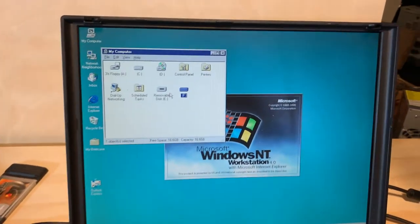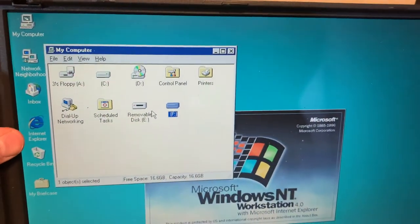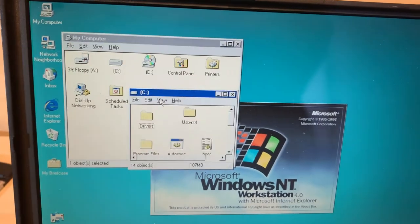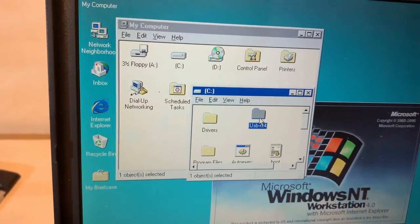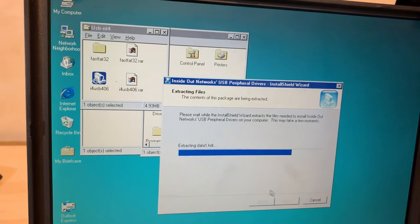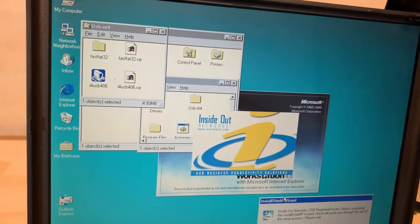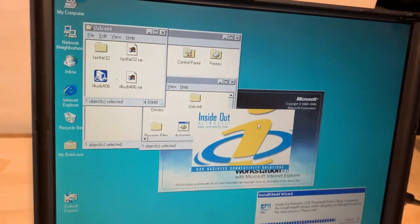Well, look at that. We have a removable disk we didn't have before. I'll show you what I did. One, I removed the wireless card utility off of this machine, as I wasn't sure if that was conflicting with anything. But I also reran this executable that I got from Vogons or WinWorld PC. You Google that file name, you'll find it